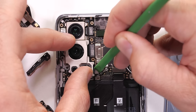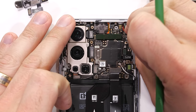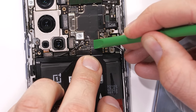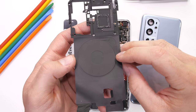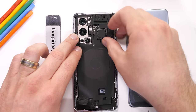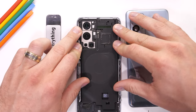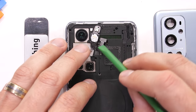And then we have the 8 megapixel telephoto camera, which also has OIS. They fit snugly up here into the top left corner, tucked up to the edge so they don't split the motherboard like they would if they were sitting in the center. This also helps keep the camera hump to a minimum and keeps the phone more thin. The front facing camera is a 16 megapixel little guy. I'll just tuck him up here into the frame. The motherboard has two screws holding everything in place. Then I can get the batteries connected with their single connector and the final extension ribbon. The last thing we need to install before we see if this phone works is the wireless charger. OnePlus is calling this Warp Charge 50 Wireless, which is kind of a mouthful. But it can wirelessly charge the phone from 1% to 100% in just 43 minutes, which is even faster than most wire chargers out there. The copper coils inside this wireless charging pad have been increased 10%, and it hits that 50 watts of charging by juicing up both batteries at the same time. Still pretty impressive.